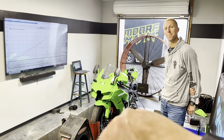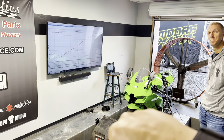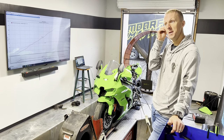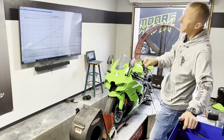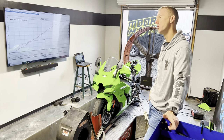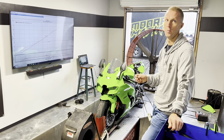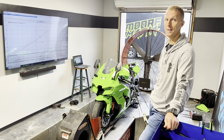Let me ask you a question though. If you're on throttle and you just release, that's where you get that throw. If you're coming off slowly, at a certain point it's cutting them off. Okay, so it's automatic. What people complain about when they're riding is that when they ease off the throttle and then go to get it back, it's an abrupt jerk, and we can correct all that and smooth that out. You do have to relearn how to ride the bike a little bit, because if you're coming into a corner and you let off the gas and you're expecting the engine to slow it down, it don't really do that no more. We're keeping the on-off throttle smooth by keeping the throttle on, basically. You know what I mean?